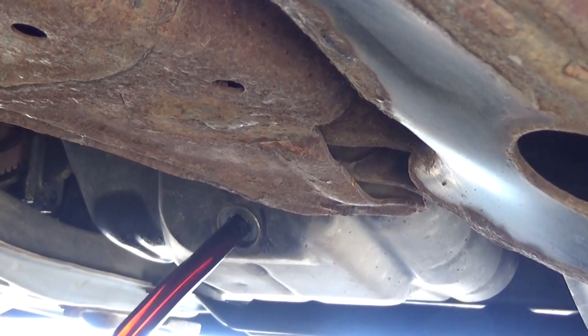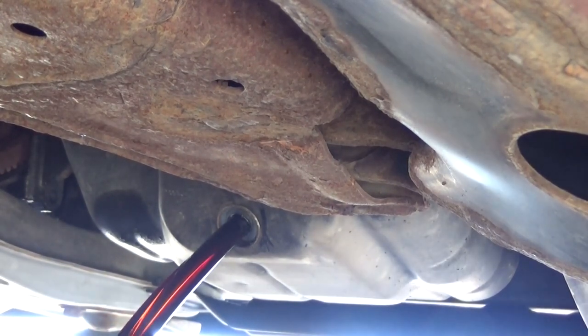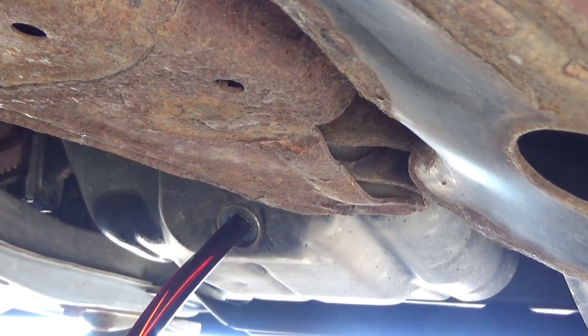You can see that oil has a nice reddish brown color. It's got a little oil dilution — I think I've got a fuel injector that's leaking a little bit. But it's not coming out black, and that's at 5,000 to 5,100 miles.